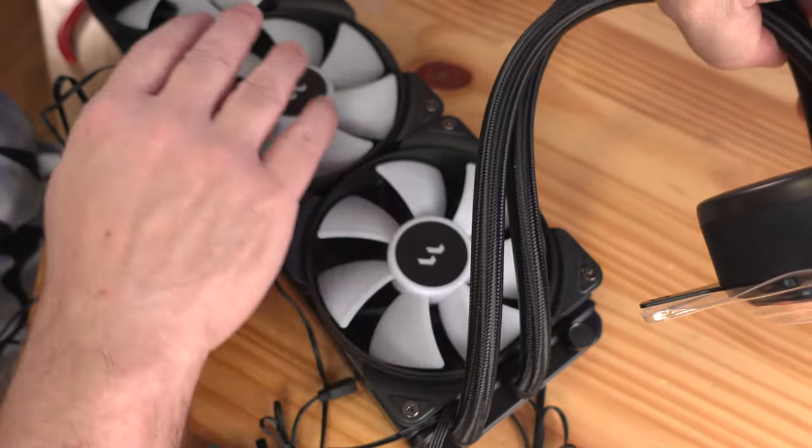These little pieces here are going to come over the edges on the AMD retention mechanism, locking it into place. Once we screw it in and both sides are clamped, that's going to make it incredibly tight. I'm going to have it with the hoses facing the memory. Slide the other piece through this groove over here — it locks right in place. There's pre-applied thermal paste, but you can use your own. Push it down, put that little clamp over one side, then push it down and push the clamp over the other side.